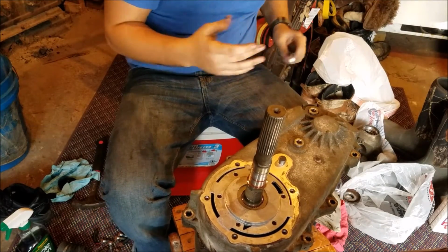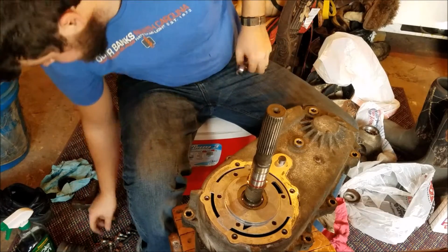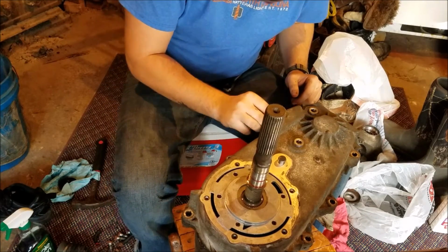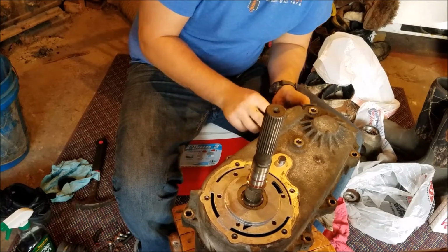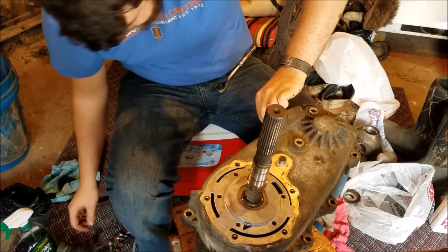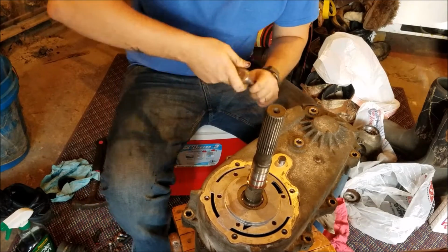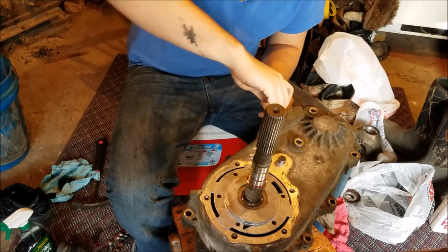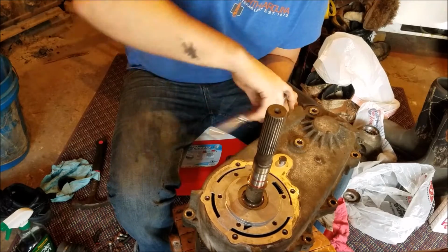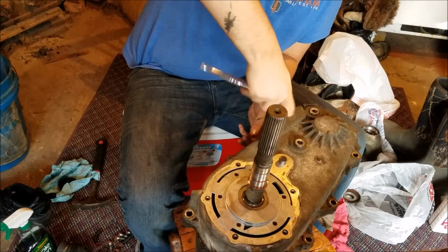Alright, time to get all these bolts in. These ones are the 15 millimeter. You're going to want to make sure you get those in there. They say to hand tighten them, but with these you can definitely make them tighter than hand tight, just as long as you can tighten it back up again, maybe even half a turn after about an hour.